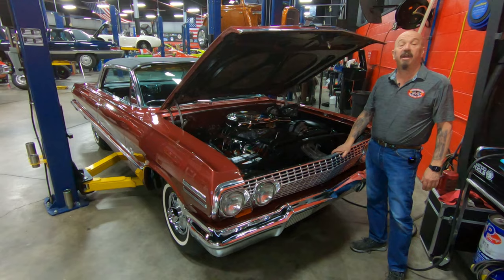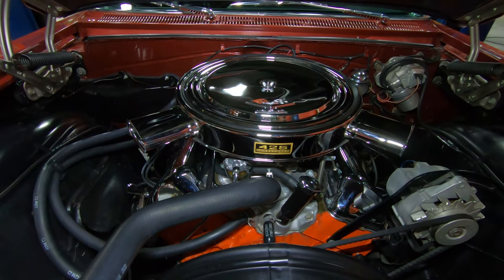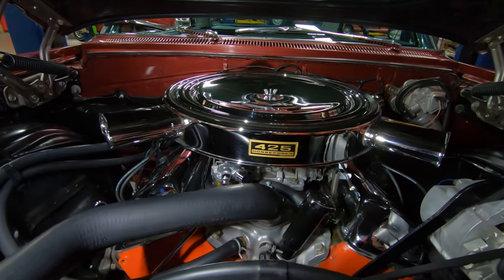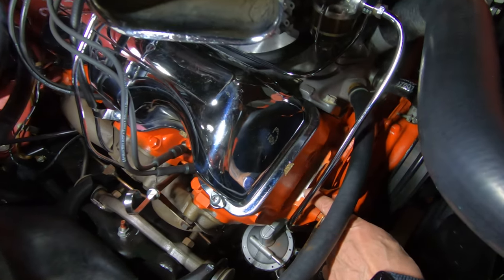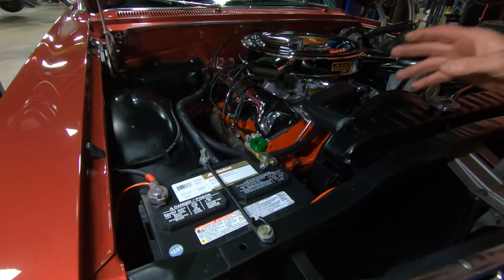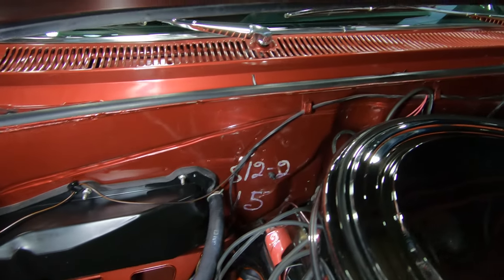We're going to lower this baby down right now and take a look at that 409. Under the hood here — I looked up the casting number on the block and the block tells me it was born a 409 motor, from '63 or '62 to '65. It is not numbers matching — it does have the correct Carter four barrels on it for a 409 dual four car, but the motor wasn't originally in this car. The suffix on the pad right here tells us that. The motor was definitely out of a different car, but it is date-code correct and it was a true dual four motor when it was born. The exhaust manifolds are all cleaned up looking good, and of course those W-shaped valve covers everybody recognizes from the 348s and the 409. The firewall is all nicely painted — you can see the chalk marks or grease pencil marks back there.